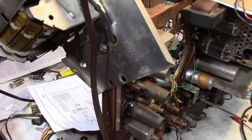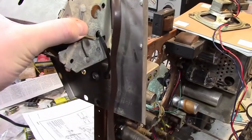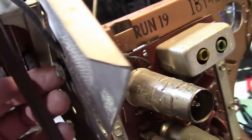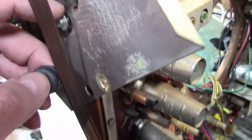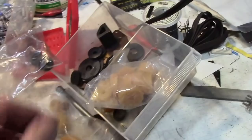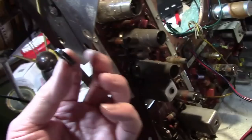Something else I'm trying to address now is the tuner — I had noticed it was quite loose. Well, it turns out it's only held onto the chassis by two sheet metal screws. The real problem is they used similar insulating washers like I'm used to seeing on old radios. The original ones are completely rock hard and rotted away. So these are ones I've picked up over the years for radio restorations — perhaps these will work. Otherwise I might have to get a little more creative and use something like plumbing washers, putting one on either side.